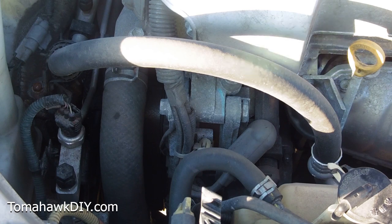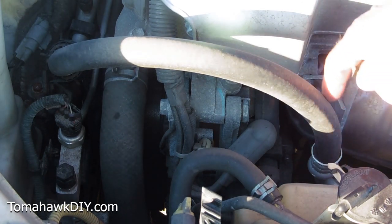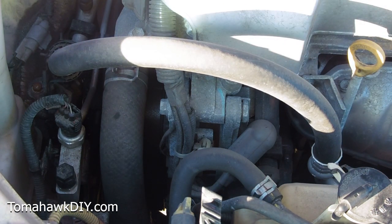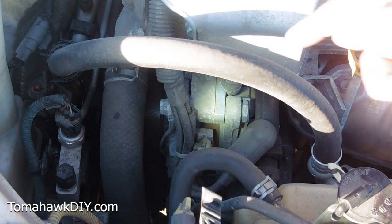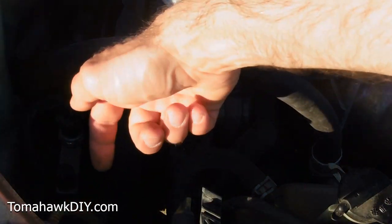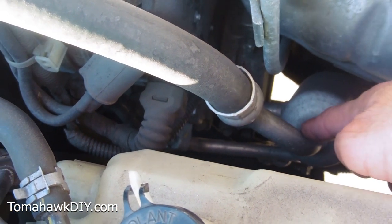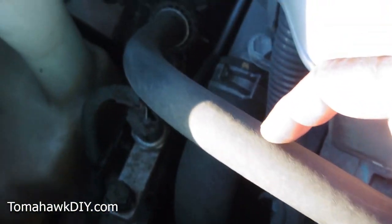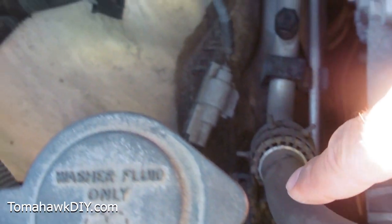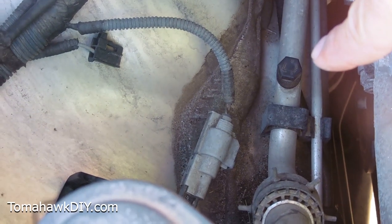AC Pro warns that electric vehicles and ones that don't have a compressor — you can't do this with. We're looking for some tubes. There's one here that's larger. If we follow the lines we find they tie into the radiator at the front of the car, which helps dissipate the heat. I believe this is called the expansion tank. Following this line around, we're looking for the low pressure port. We find this little black cap with an L on it — that's the low pressure port.